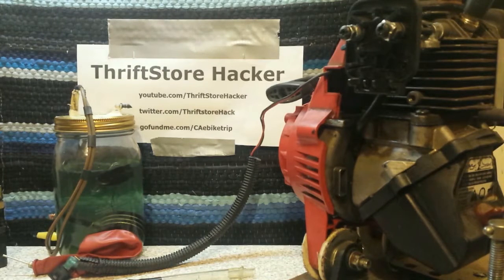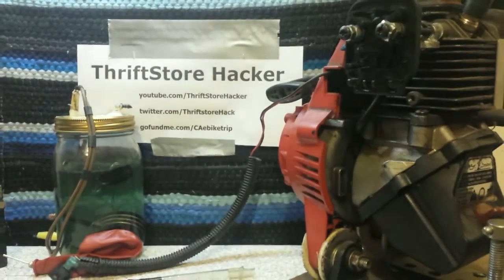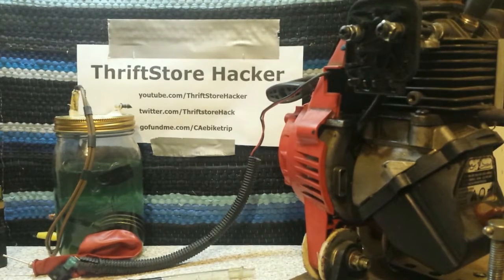Whoa, holy crap — it was a good thing that I did not fill the balloon all the way up. I think I just scared off every bird in the neighborhood. What happened was we didn't have a safety preventer between the balloon and the carburetor, and as I mentioned, we might need to play with the ignition timing. We can tell the ignition timing is a little bit too early because when the spark went off, one of the intake valves was still open, and since the intake valve was still open, we had a backfire up through the carburetor. Since it went up through the carburetor and started burning all the fuel in there, it burned the fuel all the way down the line, and when it got down to the end of the line, the balloon was there, and of course the balloon ignited, puffed up for a second, and it exploded. So we'll figure out how to put a safety preventer in between the balloon and the carburetor.